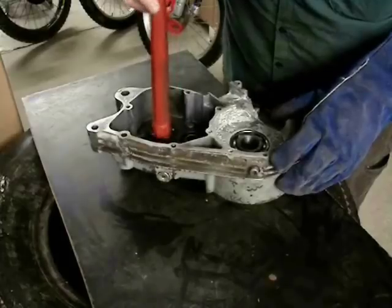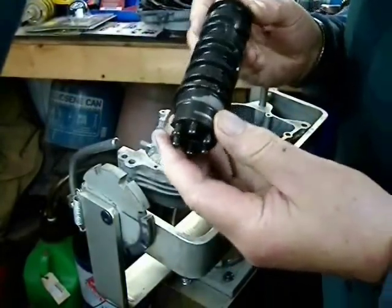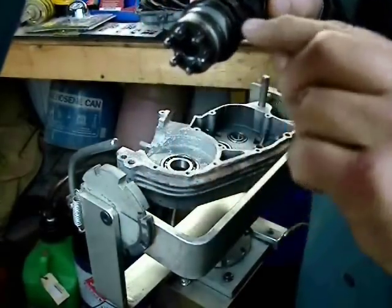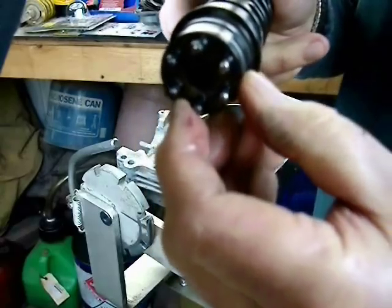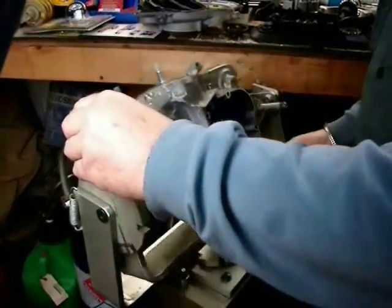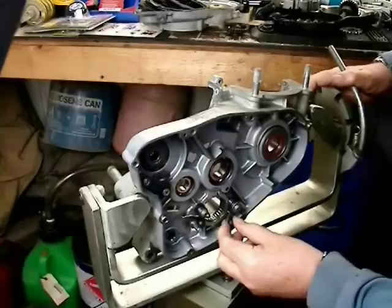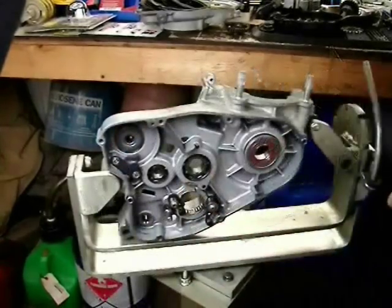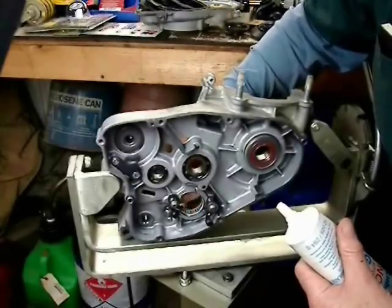I have this engine stand for many years — it's universal for motorcycle engines. Ready to reassemble, I found a galled area on the shift drum where it rides on the needle bearing; it had worn away the hard anodized coating. I had a perfectly good used one in the workshop so I used it. It probably would have worked, but with the nice one it will shift a little better. There are two spring-loaded wheels — the inner one is your neutral, the outer one is for each gear — and lithium white lube on the bearing.